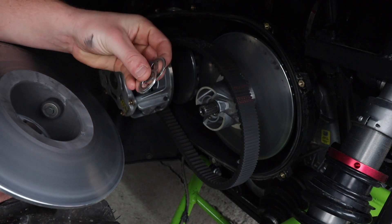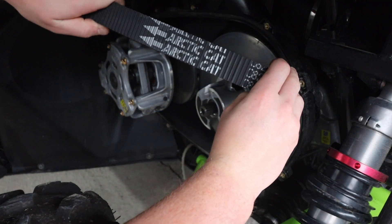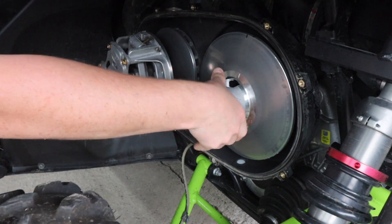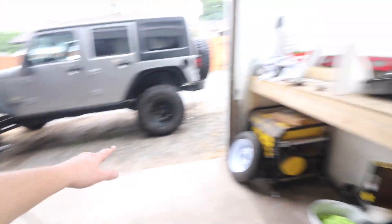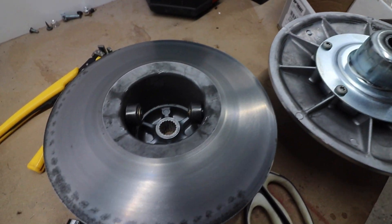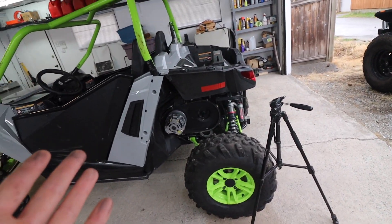There are 4 bolts right there. It says Arctic Cat and there's arrows — make sure the arrows go that way. Your spring is inside here. Now that we got all that off, we're going to start with the secondary clutch. Once we get it done and installed, we're going to brake clean it because all the belt dust in here — look at my finger — all that stuff can cause problems for your CVT.